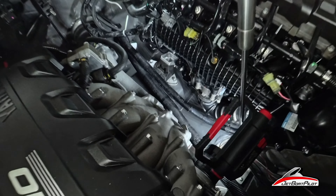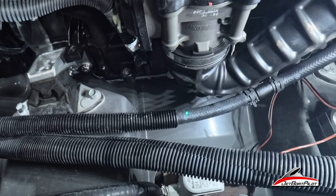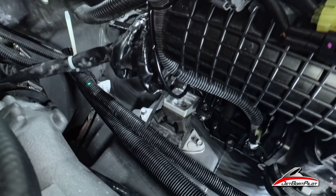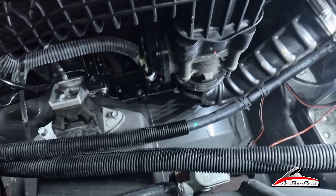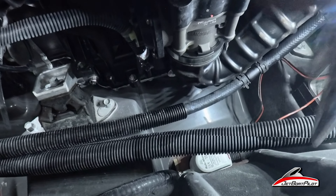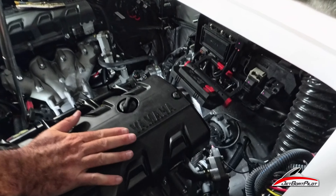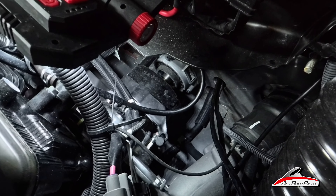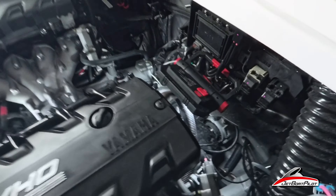Inside the engine room now on the 255 FSH — I'm going to light up the hose with this green laser pointer. Follow me back to the transom wall; that hose comes through that big hole right there. There's two hoses coming through there: one is a steering cable and the other is the hose that goes up for cooling water up to the supercharger. We're going to clamp off that hose right there — that one's really easy to get to. Now over on the engine water side, that's going to be the spot we're looking to clamp off with the second set. And now that set is also crimped off and water cannot get into this side.